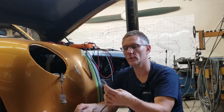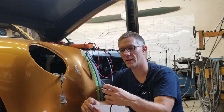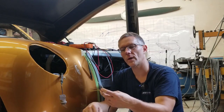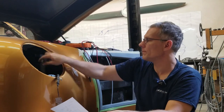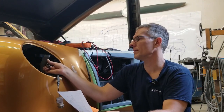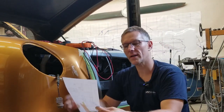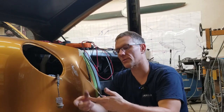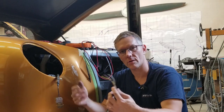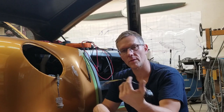High beam is yellow and blue — so that's that wire there. Brown is ground. Who would think? Usually brown is black, but in today's cars you can never tell. And white and blue is low beam. In regards to the Mustang, light green and white is the low beam, and yellow white is the high beam. So since these connectors are no good to us, we're going to take and chop them off, strip the wires back, get some shrink wrap, slide it onto the wires themselves, and solder them up. That's going to be the new pigtail, new plug for the Mini Cooper headlights.